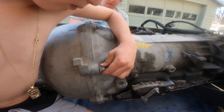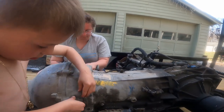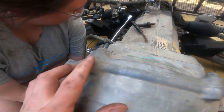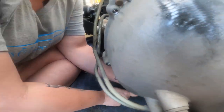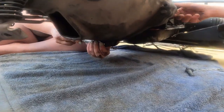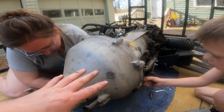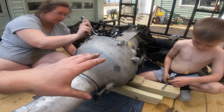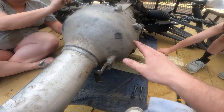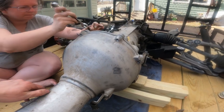Cohen's getting that bolt and mom's working on the other side with those ratchet wrenches. There are a couple down here on the bottom, a couple on top, and one right here. Before we undo the last bolt, we stacked the transmission for support — we put some two-by-fours down. Now the torque tube is ready to come free.